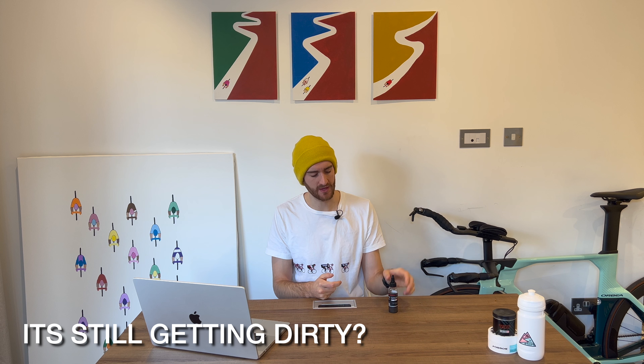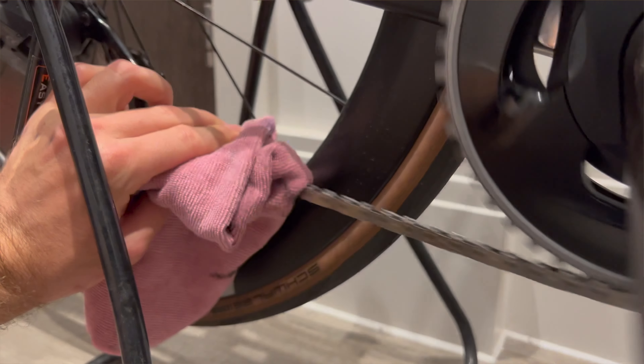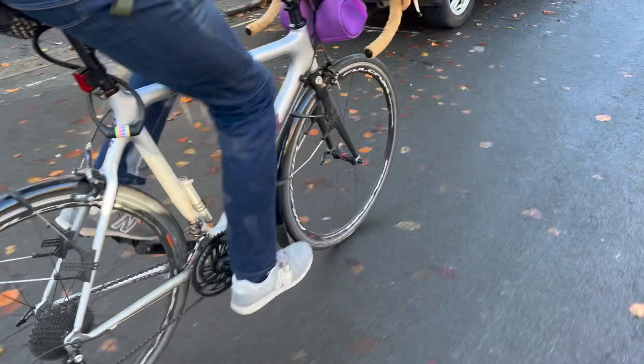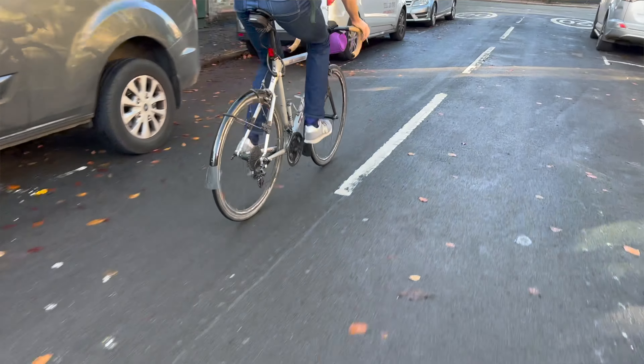Generally speaking, if you do see your chain dirty, you've either used too much lubricant or haven't wiped off enough when you first applied it. You only want the chain lube deep within the rollers — it doesn't need to be on the outside at all. They claim 400 to 500 miles, and generally your chain will get louder as the lubricant deteriorates. For me, around the 350-mile mark is where it starts to get a little louder, so that's probably the sweet spot for re-lubing. After commuting in the rain here in the UK, the chain is still completely silent after about three weeks straight.